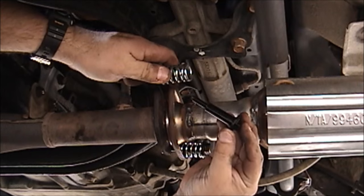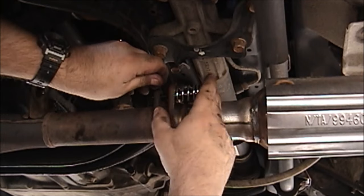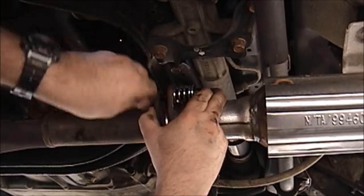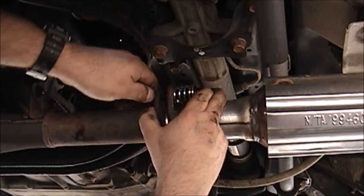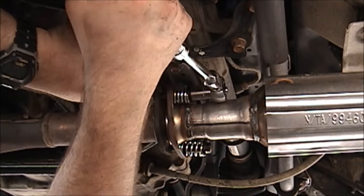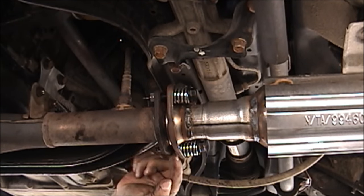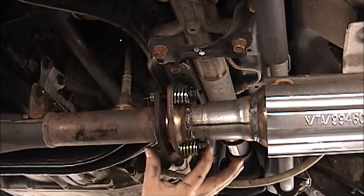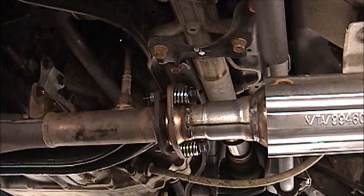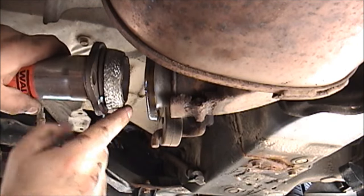New hardware from Walker — that's right for the application. Put the spring on, put the bolt through, and get the nut started. You can't really over-tighten this because the bolt bottoms out on the two flanges, so all the nut really does is hold the bolt in place. Then it's just spring tension and that gasket to keep it from leaking. Now I'm going to put my gasket on — it goes on nicely because it's going onto a nice new pipe.